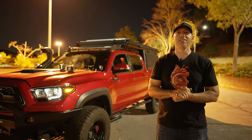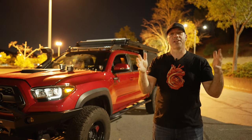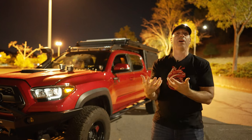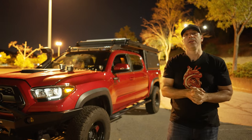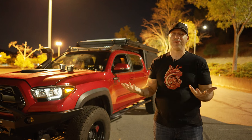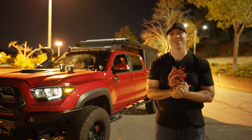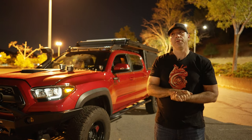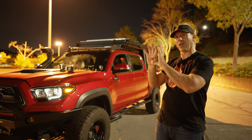To conclude: the Rigid D-Series wins this particular battle — the light is clearly the brightest at 3,200 lumens. However, the drawback is that the light throw is very square, acting more like a spotlight even though these were floods. That's not ideal for ditch lights. The other problem with the Rigids is they're just so heavy and bulky, and the design isn't really modern anymore — they were great five to seven years ago, but now they feel dated. I remember paying about $200 for those.